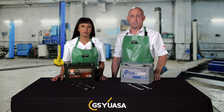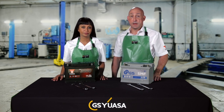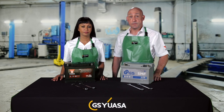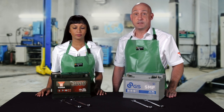Gas emissions produced by batteries can cause a further hazard. Hydrogen and oxygen gases are both produced during recharging. These gases may also be emitted at other times, for example if the battery is moved or shaken. The hydrogen gas is explosive at concentration levels above 4% in an enclosed space. The results of an explosion can be extremely serious. Therefore, always store, charge and install batteries in a well-ventilated area.